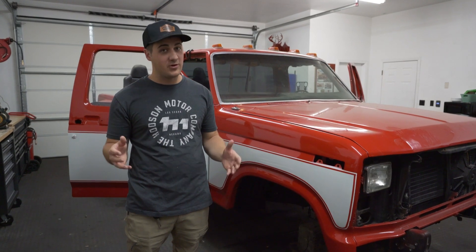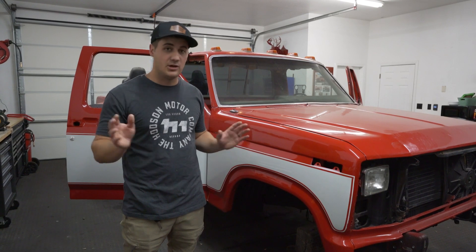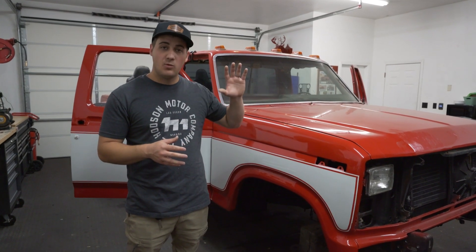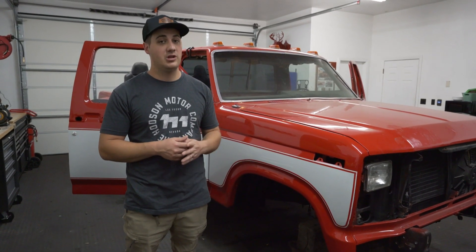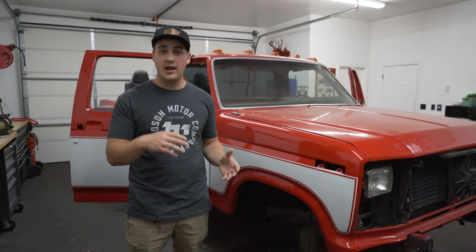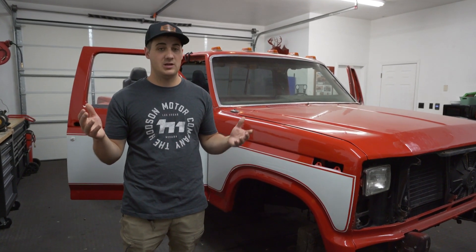A Dana 60 front axle out of a '90s F350 is a phenomenal axle — incredibly strong, really just the best axle you can put in for a swap. They're hard to find now because everyone knows they're great and they're gone instantly as soon as something hits the junkyard. But we had one, and we're really lucky. Maybe a coil spring would ride softer, but with the Skies Off-Road shackle reversal we're using it's going to ride really nicely. As for the transmission swap: these trucks had a T15 or T18 four-speed manual — a good heavy duty trans, but four-speed with no overdrive. First was a granny gear and fourth was one-to-one, so these things topped out at like 65 mph just revved out.